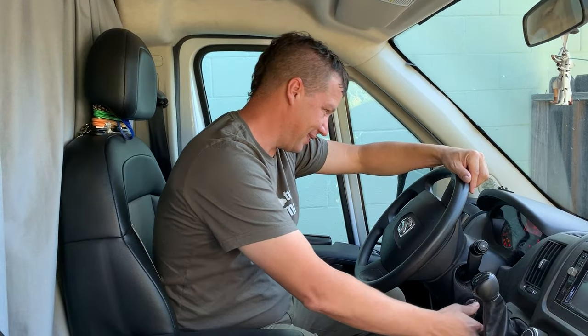We've killed our battery in the past before and this time it would not jump start or take a charge, so it was time for a new battery. We went down to the dealership — when you go, make sure you have your VIN number with you. It's on the inside of the door and also on your registration tags. Give them that number, they look it up, and they know exactly what battery to give you. While you're at it, ask them if there's any recalls, because that same VIN number also pulls up the recalls on your vehicle. If you have the vehicle worked on at the dealership for a battery replacement, they're going to charge you here in California a minimum of $75 an hour plus the cost of the battery, so that can get quite expensive. I hope you enjoyed this video and found it helpful — if so, please subscribe and hit that thumbs up and we'll catch you next video. Let's see if this starts. Yes!